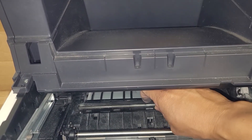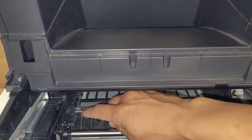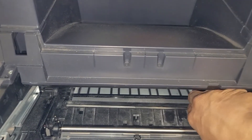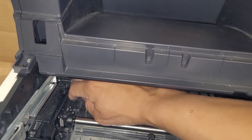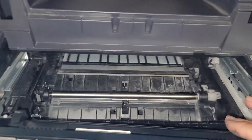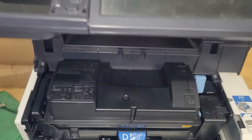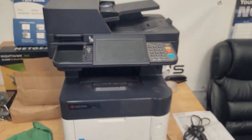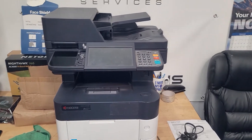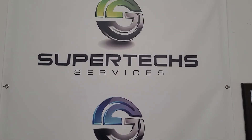The last step is putting the transfer guide plate back on, and this one's really easy. Just slide it back in place and move it to the right — I'm doing this one-handed, but with two hands it's a lot easier. Slide it over to the right and it'll snap in place. I'll snap it back out just so you can see, and then snap it back in. Then you can roll the transfer roller and just make sure that everything is in place. Put the drum cartridge back in and that's our video for today on how to replace the transfer roller assembly on a Kyocera M3550 — this also works on other models. Please like, comment, subscribe, and we'll see you on the next video. Thanks.